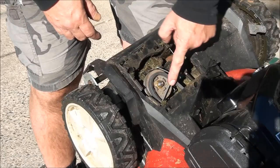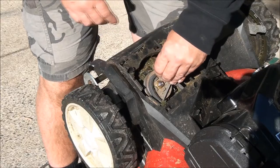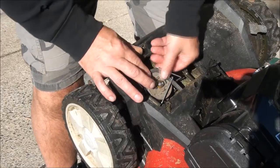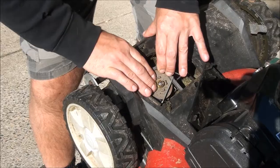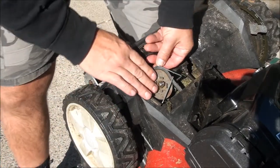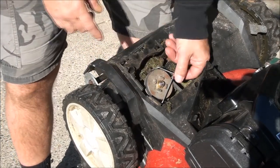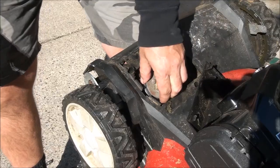These wires here are supposed to hold the belt on the pulley and they just pull out if you need to remove them. You should be able to stretch the belt on because they move — you can rotate the blade to get things to turn. The belt's back on now. I want to make sure all these keepers are still in place and none of them are broken — we're good.